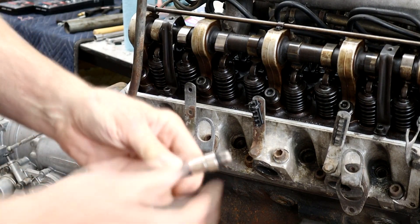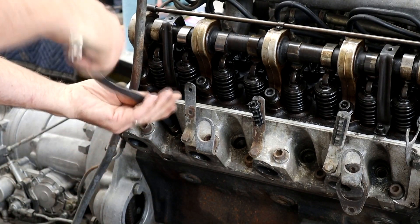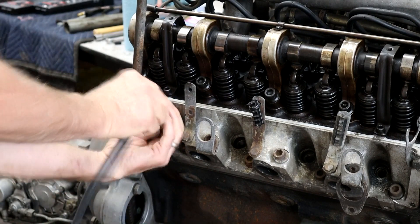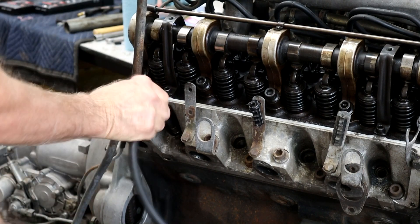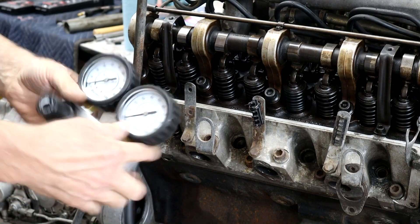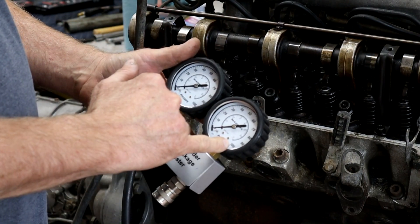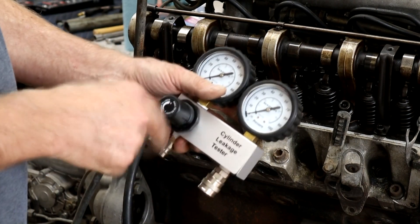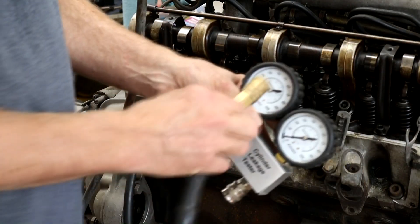Next thing to do — we've got this hose. I don't need my adapter on this one; it's got various adapters for different engines. We'll screw that in there. Just for reference this is number four cylinder. Get that nice and snug — you don't have to go mad. Then we connect the leak down tester. I've seen different ones; there's one where you bring the right-hand gauge all the way to zero in the green. This one is slightly different — you make sure it's turned all the way down to the lowest position. Then we get our air supply and put 100 psi into the left gauge.